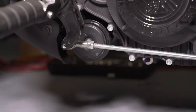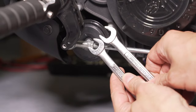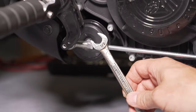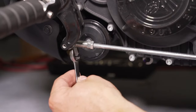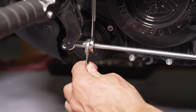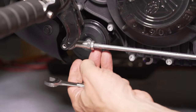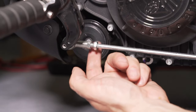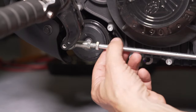You're going to need two wrenches. You can use a 12 millimeter and a 13 millimeter, or a 7/16 and a half inch — either one will work. In this case I'm going to use a 12 to hold this swivel head in place, and then to break the jam nut I'm going to use the 13 millimeter. Remember: lefty loosey, righty tighty. The jam nut is regular threaded, so I'm just going to back it all the way up to give myself room to work.